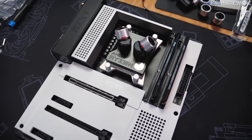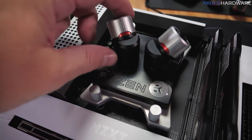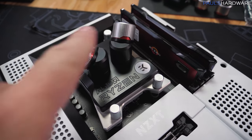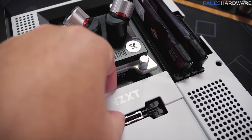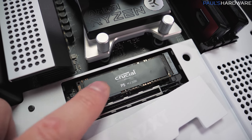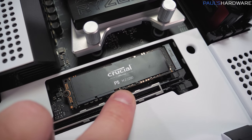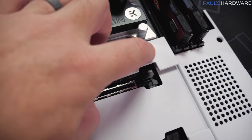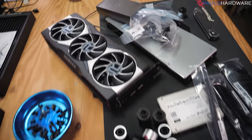The motherboard is set up with the CPU water block installed. I popped on a couple of 45-degree rotary fittings with compression fittings on top — it looks really nice with the red accent, silver, white, and black color scheme. We also got our P5 NVMe drives installed under these magnetic panels that cover the M.2 slots. I wish they were heat sinks since the P5 can get hot under sustained loads, but it throttles itself before any overheating. With both drives installed, we can pop the motherboard back in and move on to the GPU water block.